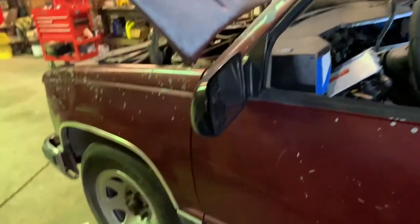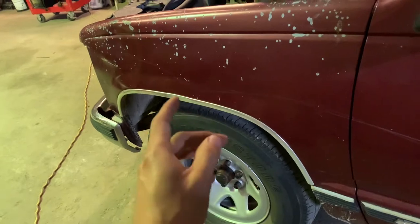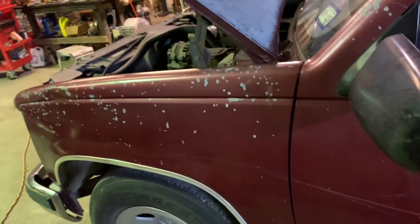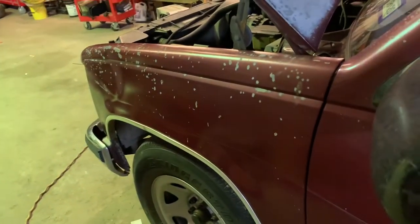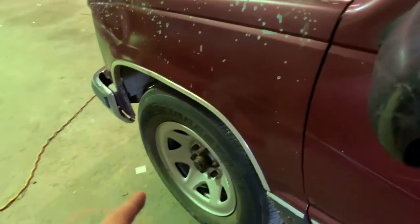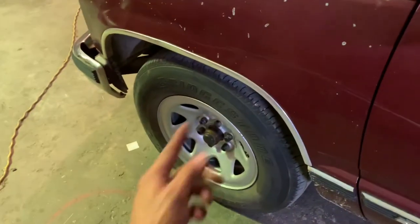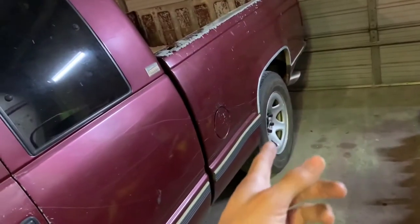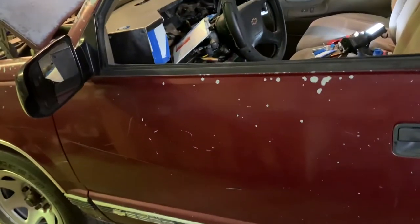On Amazon I also bought brake pads for the front because the passenger side needed serious attention. When I swapped out the old tires and rims, that side's wear indicator was almost touching. I was glad I caught it before it got to the rotor, because buying two new rotors on a six-lug truck is expensive — on this truck the rotor is integrated with the hub, not like a four-wheel drive where it just pops off. Luckily it's a 14-bolt rear end so I'm good there.